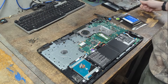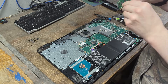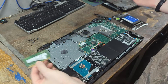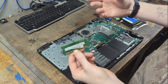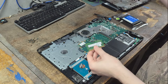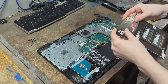So we're in. We're going to be upgrading the RAM — actually, this is something I was not aware of: this laptop only takes one RAM slot. Not a huge deal, I can just put one 8GB stick in. If you're watching this before you tear it down, I apologize. Task Manager showed one of two slots filled, so I assumed two slots existed, but that's not always correct. Either way, we're upgrading to 8GB — 16GB isn't really needed for a Pentium anyway.